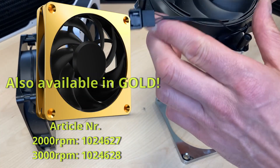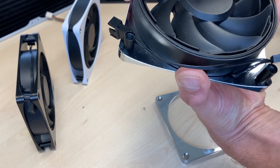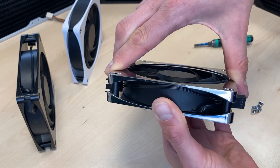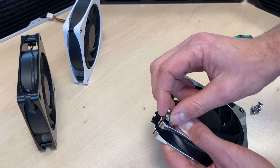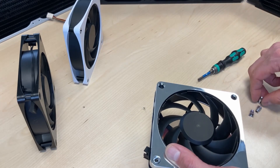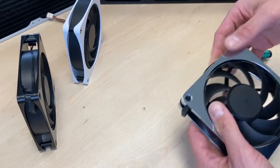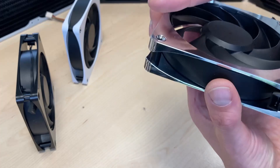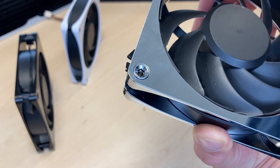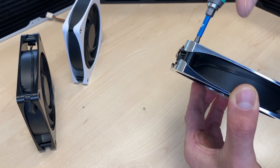Let's try to put it so that both connectors are on the outside. From the four corners, I'd need a third hand right now, but let's give it a try. This is already stable. I'm going to screw the tiny screws in, just not really hard, but so that all four are in. When mounting, it's always a good idea to use the opposite position first so it's already a little stable. Now we can still move the fan on the inside and find a good position — exactly the right distance to all corners. It looks pretty good from the front, so now I start tightening it.